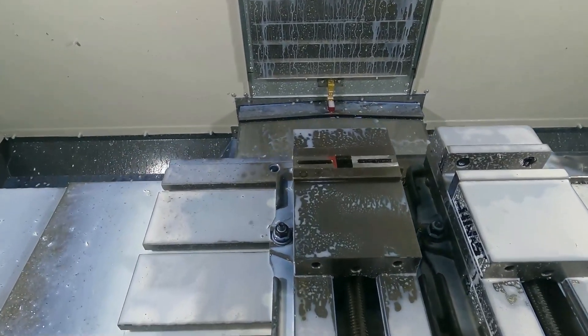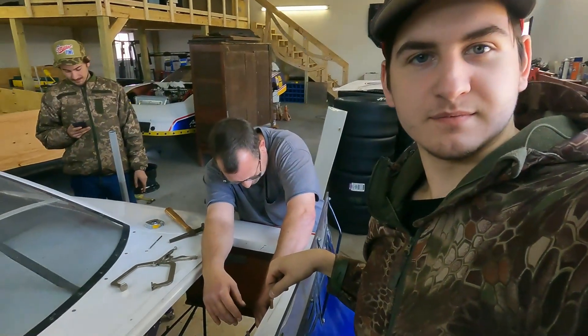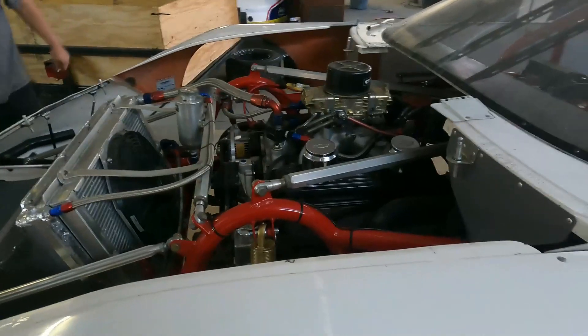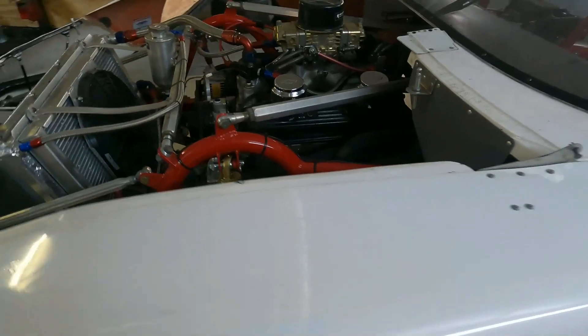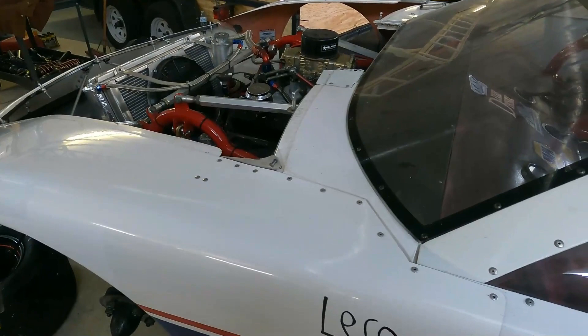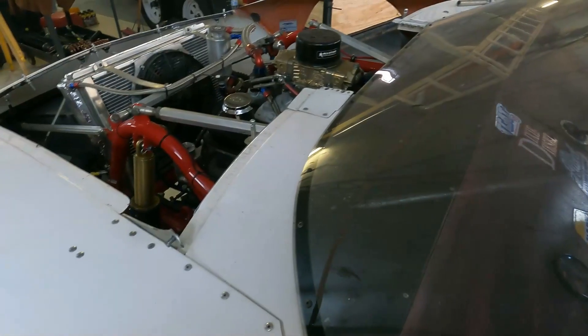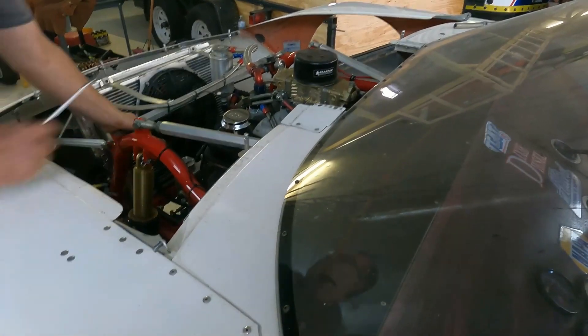That will work for what we are doing. I need everybody's help real quick — does that right there look like it's got paint on it to you? That ground part. Someone in the shop thinks there's paint right there, y'all let me know. Now we're going to run these cars real quick. When you take a motor out and you're not going to run it for a while, you're supposed to pull the rocker arms back and let the tension off the valve springs. But since these aren't really sitting here all that long, nothing to do that — we just run them every so often.